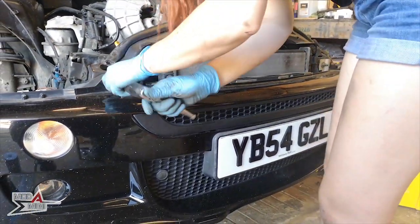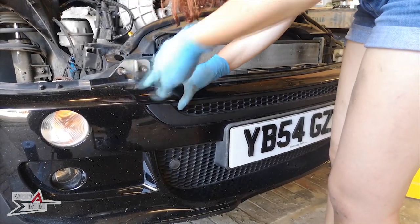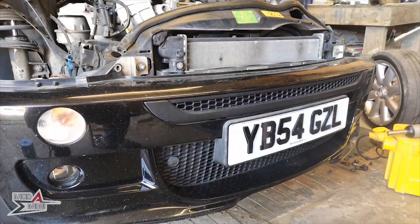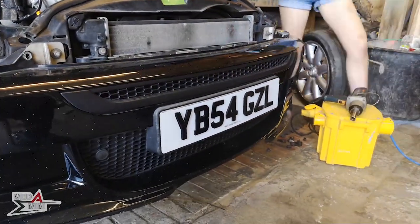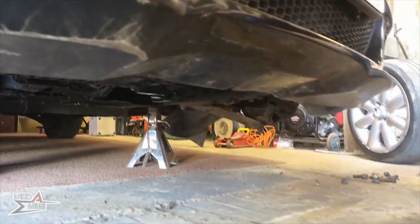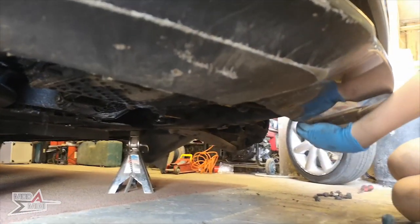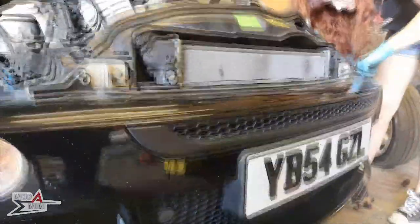Next up, you undo the two Torx bolts at the top of the bumper either side of the radiator. I quite like this job because I get to use my favourite little socket that looks kind of like a flower, kind of like a star. Bear with the fact that I have absolutely no idea what my hand is doing with that ratchet - I hadn't quite mastered it. Usually you would have 10mm bolts running across the underside of the bumper along with an undertray, but these were all missing on ours - kind of good news because it made the job quicker. You will have to remove some electrical connections as well; however, the whole long nail thing meant that I can't quite clasp the clips, so John's hand does appear a few times in this bit.